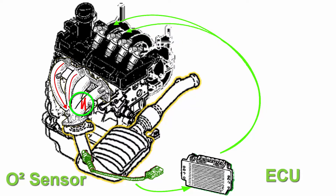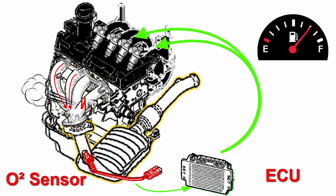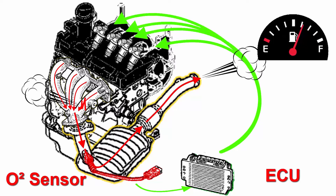As we have a major crack on our exhaust manifold, some of the gases escape through this crack. The O2 sensor considers this as a lean air-fuel mixture and sends wrong information to the ECU. To compensate, the ECU sends a wider injector pulse, resulting in poor fuel economy and unburnt gases in the exhaust pipes, which can lead to damage to the catalytic converter, here represented in yellow.